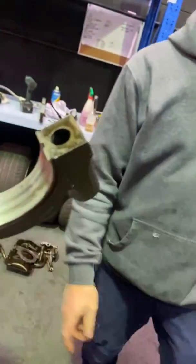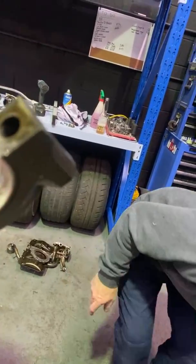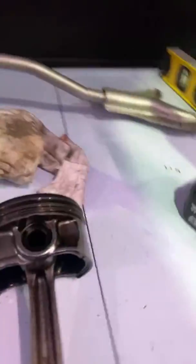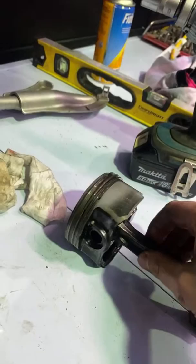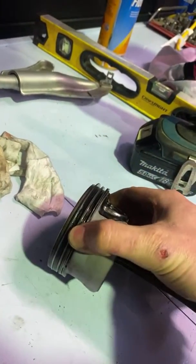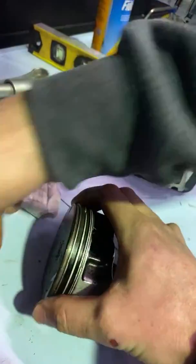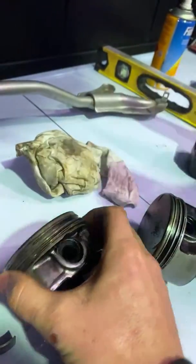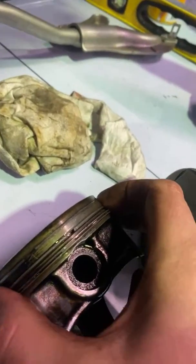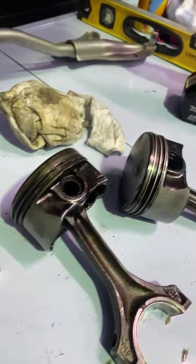Yeah, I know. How's that one looking? Most of the bearings have definitely seen better days. And the rest of the piston rings, can we have a look at them? Like we said, this car had a lot of blow-by, but there's no cracked piston rings at all. Are they all floating? None of them are stuck? Yeah, they're all floating. So no cracked piston rings, which is really cool, because I would be a bit gutted putting that engine together myself and then seeing some cracked rings.